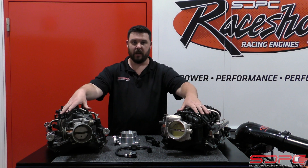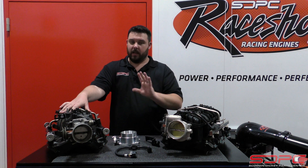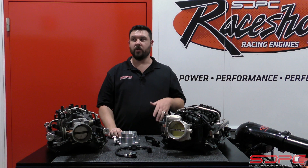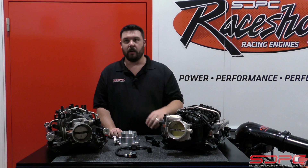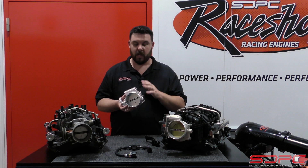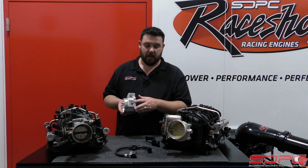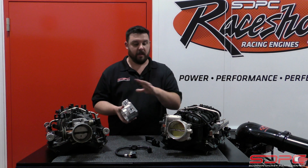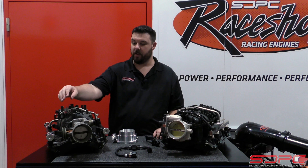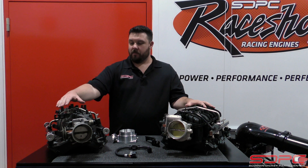The whole benefit of this swap is performance. As you can see, the body of this intake manifold is much smaller than this one. The plenum volume where all the runners meet inside is much bigger, the runners themselves are bigger and shaped better, and of course it's a bigger throttle body snout. You can use the adapter and it'll run fine — it's not going to run bad and I don't even think you'd lose any performance. But the whole reason you're doing this is a performance upgrade, so what we would recommend is grabbing one of these Nick Williams throttle bodies. This is what I put on my personal truck. All these intakes were used on drive-by-wire, while your old intake was cable, so you have to find a way to adapt the throttle cable.